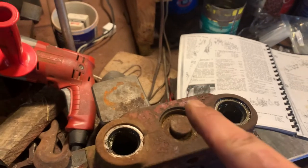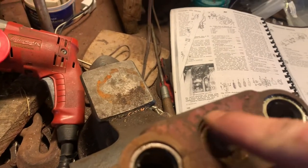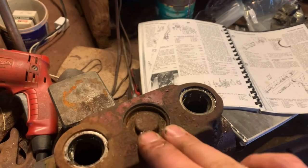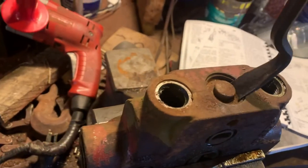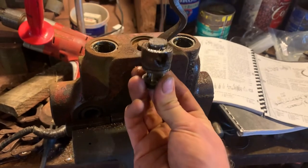The last thing that you've got to do is this check valve — this is what gave me the most trouble, again because this tractor's been sitting out. There was a snap ring, but it looks like this snap ring's actually gone. So I'm going to clean this up in here and spray it with some penetrating oil — let that sit a little bit; I should have done that first to let the penetrating oil get in. Then I'm going to pry up and the piece is going to pop out. This is the part that comes out — no problem. You pry it, it comes out. There's an O-ring that I'm going to replace, and this spring, and a little spool.